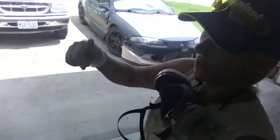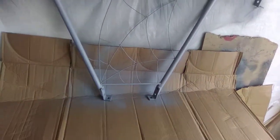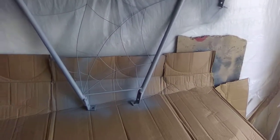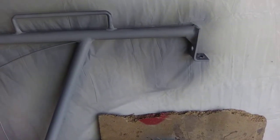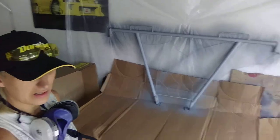I have sanded, bondoed, or ground down and bondoed the harness bar. I'm just going to spray some epoxy over it to protect it. Some of my welds broke — one of my webbing broke — I've got to take it back to my friend to redo. I should have had him do it before I primed it, but it's sitting here bare metal and I can't let it sit like that anymore. Good rust. The epoxy should protect it. Some of this is kind of ugly looking still, I'm still kind of working on it, but I wanted to get something on the bare metal so it doesn't rust on me. It's looking pretty good.